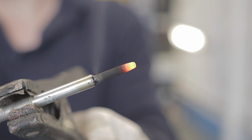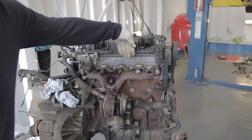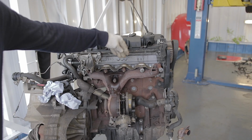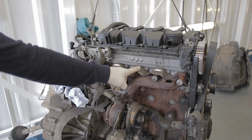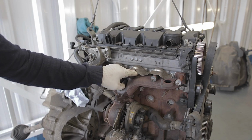That one's certainly working. So really the moral here is, it's not actually that difficult to change these glow plugs, but because they're at the back of the engine, they're in such a awkward place, it's a nightmare to get them out. And you're going to have difficulty getting down there and doing all that. And I'm sure anyone who's actually changed these glow plugs will agree, they're a little bit of a pig of a job. If these were around the front of the engine, they'd be easy.